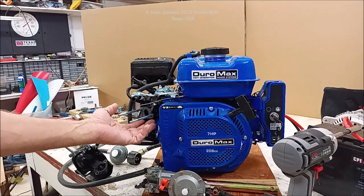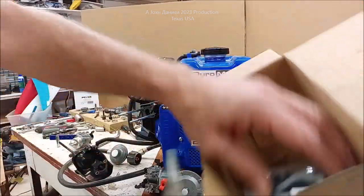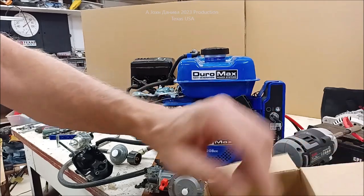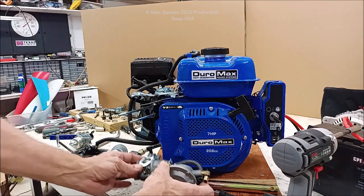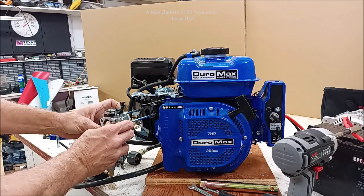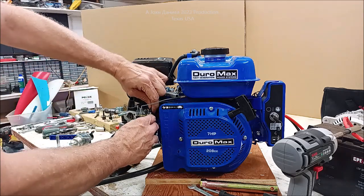And you'll see the gasket back here is still where it's at. And this kit can come with a number of different structural frame mount pieces. You see that? And we might have to use those. So far, I usually have not had to do this. And we're now going to take the carburetor, the new carburetor, and we will slide it on. There's the existing gasket still back there. It'll slide back, and we will put the fuel line on.